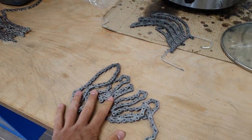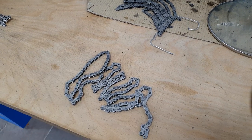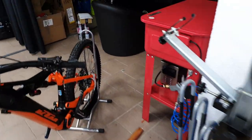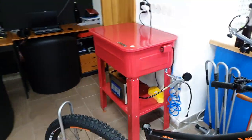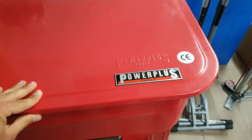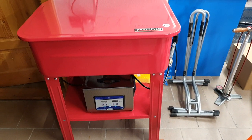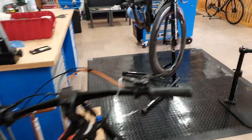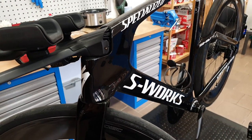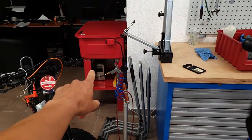The first thing you need to know if you want to wax your chain: you need to strip all your oil-based lubricants off it first, be it factory grease or some other lube you're currently using. There are many methods — you can do it at home using degreasers, brake cleaners, ultrasonics, or a normal parts cleaning bin. One thing to note: if you're cleaning a chain previously used with normal oil, it will be almost impossible to clean completely on the bike, and very demanding off the bike — you'll likely need an ultrasonic cleaner for that.